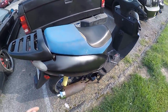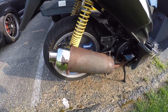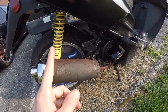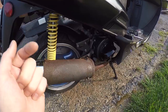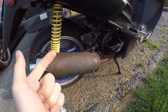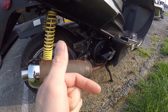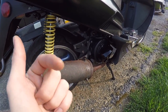What's up guys, we are back with another scooter video for the old scooty gang. So the last time I made a video on this thing, we dropped the little air scoop on it. I did order a 171 kit. I have a 28 millimeter slide carb coming in, and I also have the 171 kit coming in with the forged piston.